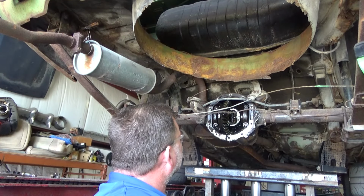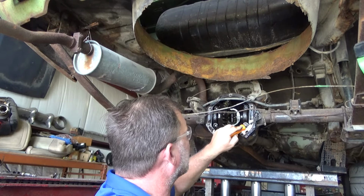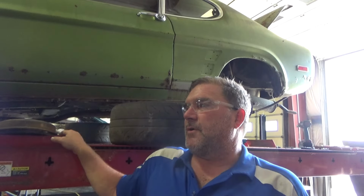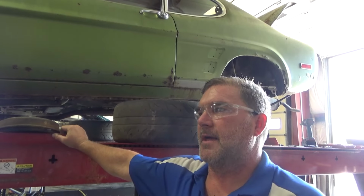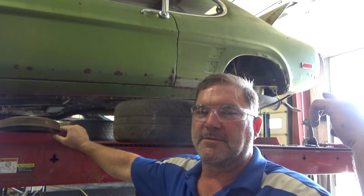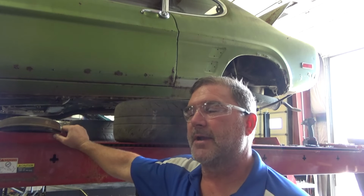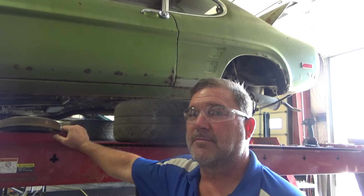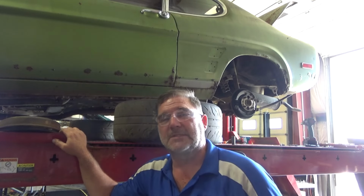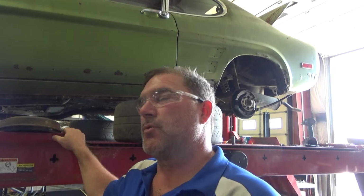All right, well, I'll go back to trying to pull the axles out the way I originally thought I needed to do it, and then I second-guessed myself. In reading the directions further, they had two different designed rear axles in these cars. So they had a bearing retainer plate, which is what I originally thought this was, and I just needed to grab a slide hammer and be more aggressive with it, and it would have popped right out. Instead, I second-guessed myself and pulled the diff cover, because there was an axle offered in this car that was C-clips, and that was what I pulled up on my mechanics data from ProDemand.